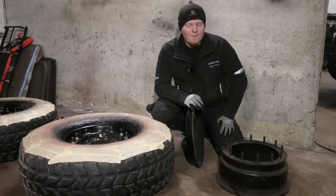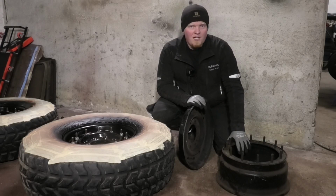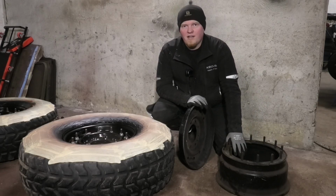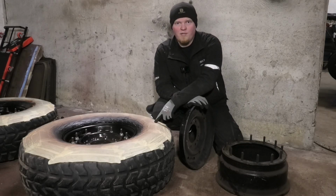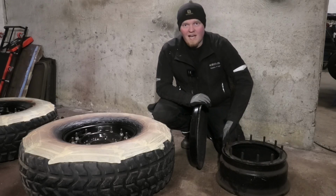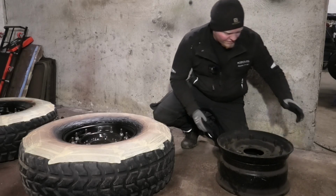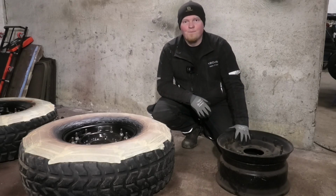on and off. And another thing is that when you have a split rim of some type, you're also typically going to have a tube inside the tire, because normally these are not going to be airtight, but these ones have to be because there's actually not room for a tube in these. So that means you're also going to have to fit a big rubber gasket around here when you go to reassemble these. And I don't actually have those for these wheels. I also don't have valve stems and all that stuff, so I couldn't really have used these anyway.